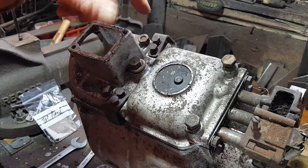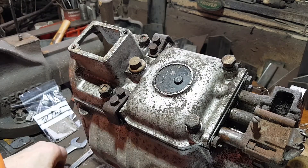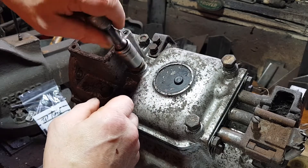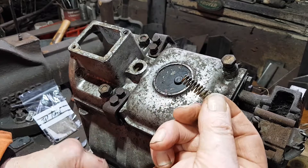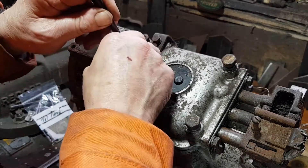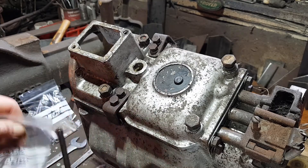Inside here there are ball bearings and separators that drop into little grooves in the selector shafts. They give you that nice positive click when you change gear and also stop it wobbling about. I take the centre one out first - so you've got the top, a spring, clean all the crap off, a magnet, and there you go - ball bearing. Old-fashioned, very basic, but it works.